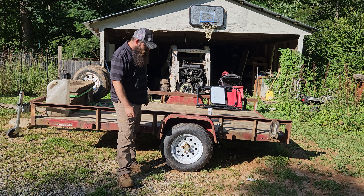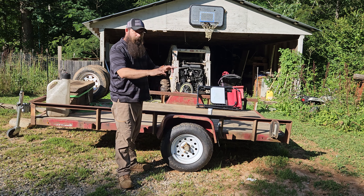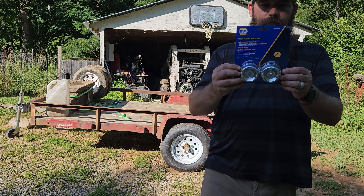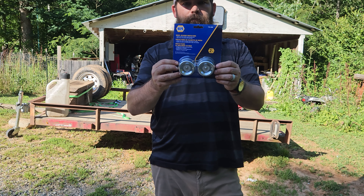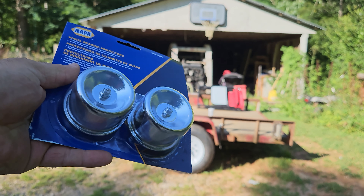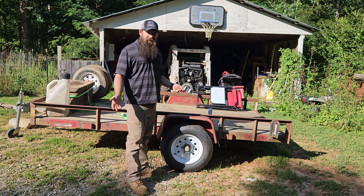Greasing is hard — you gotta take the cap off, take the wheel and tire off, and take the whole hub out. So I did a little bit of googling and I found this. There's a couple different types, but this is NAPA's version of it. Part number is 745-3046. Inside there's some little zerk fittings. I'm gonna bring y'all in here and let's just see if they work.